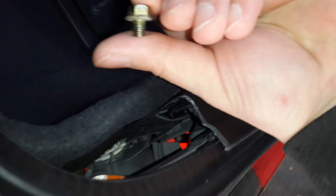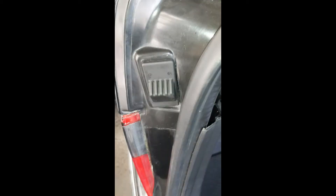You can see here this is the screw which holds this stop and it is situated on the opposite side. You must pull the trunk cover and you will see the place where it sits. As this is dirty, I clean this place before installing the new trunk lid stop. Here you can see it is already cleaned.